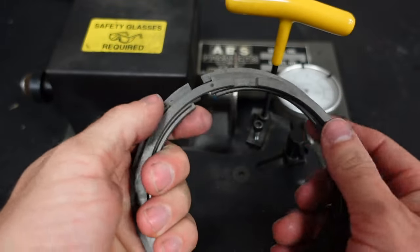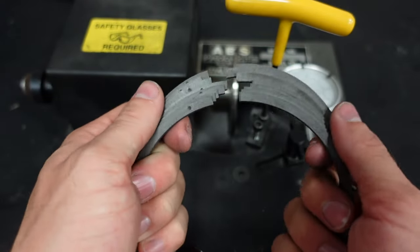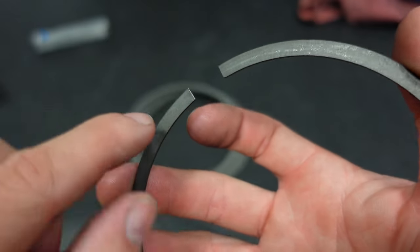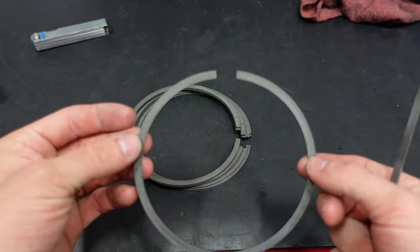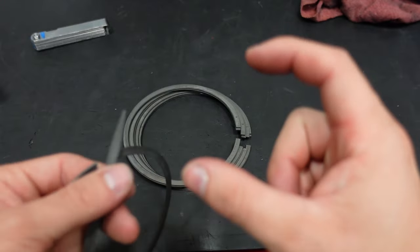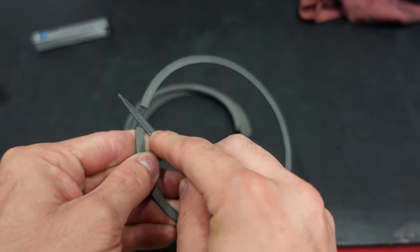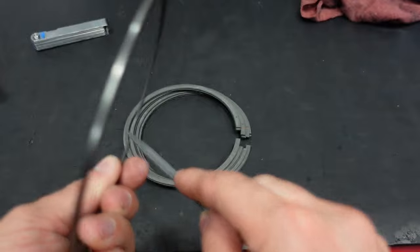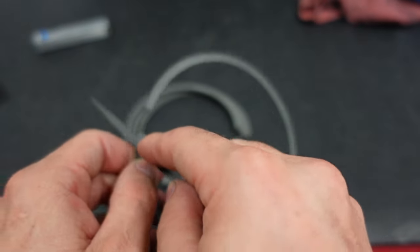All of my top rings have had their first cut made. I'm now going to clean them, deburr them, put them back in the block, and check our measurements. After cutting there's going to be a nasty little burr on the edge of the piston ring, and that has to be removed — otherwise it'll scratch up the piston and the ring will never seal correctly. There are lots of ways to remove this burr. I like to use a little diamond file and just take that burr right off. Whichever way works best for you, just take care of the burr so that the piston ring lands don't get scratched up and you have a nice piston ring that can spin freely in the bore.